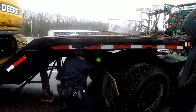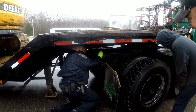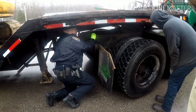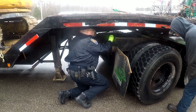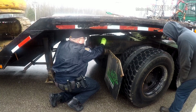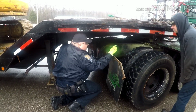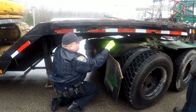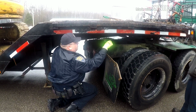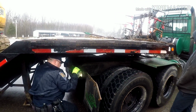Same thing on the other side. And anywhere you got these coming in, you just kind of want to check it. You got these dog bones here. Really just shine your light in, checking the bolts. A lot of people ask me, do you prefer a truck clean or do you mind dirty? Honestly, I don't mind dirty, because if the bolt heads are all dirty, like all along there, that tells me everything's good and tight. Now, if they were cleaned out, starting to waller out and spin, that's probably a good indication, hey, we got an issue.